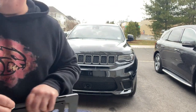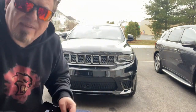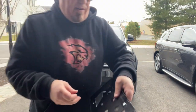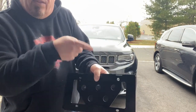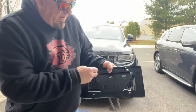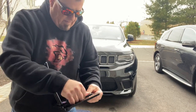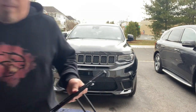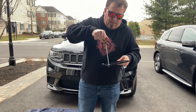They have all these spacers and washers and stuff. It's not necessary. Yes, they have these spacers, they have washers. With this extra piece of plastic, I'm not gonna need it. And you gotta make sure that when you put it on, the nut is actually on this side and not the other side, because this is gonna stick out too far. So, putting the nut forward. That's centered. All right, now we're gonna use the screwdriver to tighten it. Phillips screwdriver to tighten it. That's what they recommend.